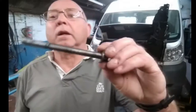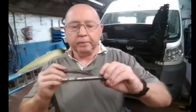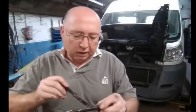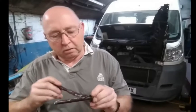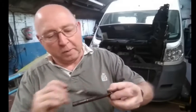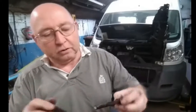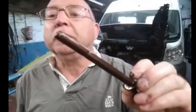I'm going to do that with all the bolts actually - the bumper, the grill, everything. I'm going to clean all the bolts because they were all rusty. A cleaned bolt on the wire wheel. I'm just going to put some lubricant on - it's the same lubricant I used for the handbrake cable. It's my secret recipe - it's just copper slip high melting point grease with a touch of engine oil. I've been using it for years and I use it for everything - door locks and everything. It works really well. That's what it should look like before you put it in.